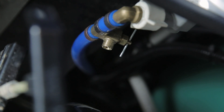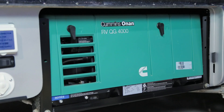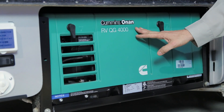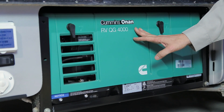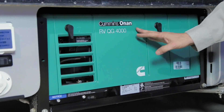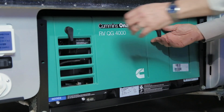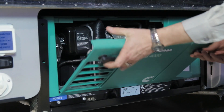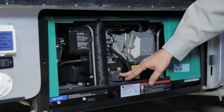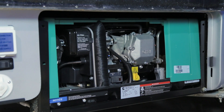The low point drain is located just above the sewer dump and will drain your entire water system. Your 2014 Pursuit is equipped with a 4-kilowatt Onan generator operating off of your existing fuel tank. Once the vehicle reaches a quarter tank, the generator will automatically shut off. The large storage door gives access to your generator components to check oil. Please refer to your generator manual for any maintenance and service.